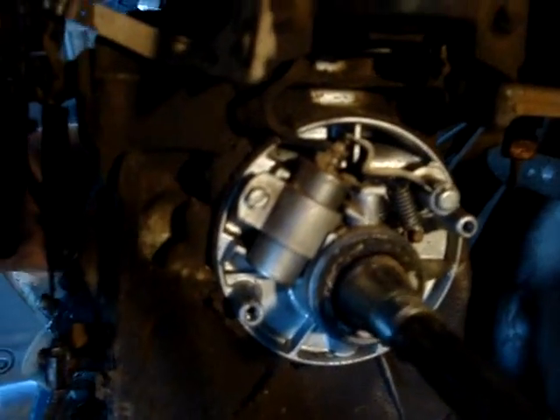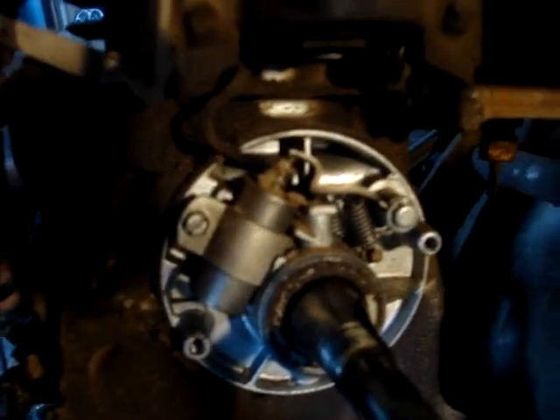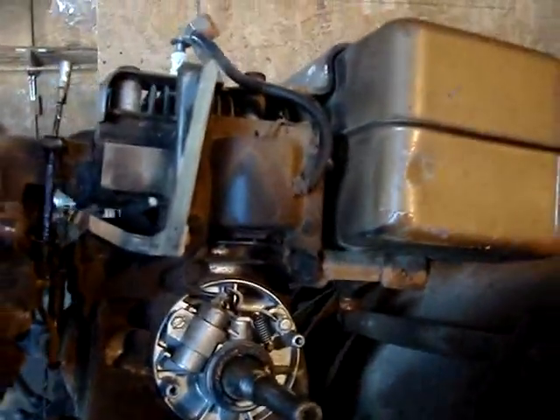This is your condenser. Your points are right here. When this flywheel turns over — there's a bump in the flywheel, just like a little cam on your camshaft — all it does is open up those points. It doesn't open them very much, so I'm going to sand them down. Then I'm going to go up here to my coil — I can see it's pretty dirty, all kinds of dirt kicked on it. That's probably the cause of our very low spark. So I'll clean that up, and also on the flywheel where the magnets are, we'll clean that up with some emery cloth. Get that all cleaned up, throw her back together, and our spark issue should be solved.